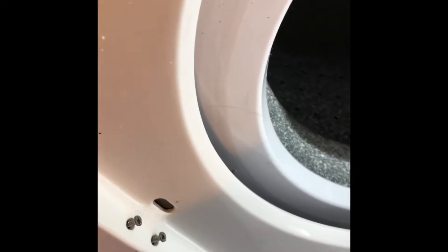A lot of times the lid switch is actually broken and you can wrap something around it like a zip tie or even some strong tape to get the two plastic halves back together again. That will get the lid switch working and then it'll spin and drain — that's a really common problem.